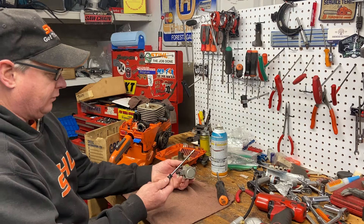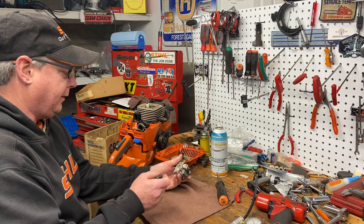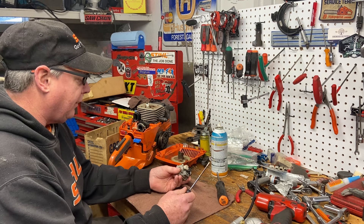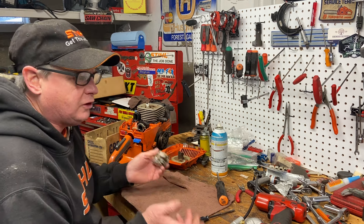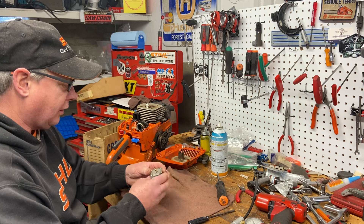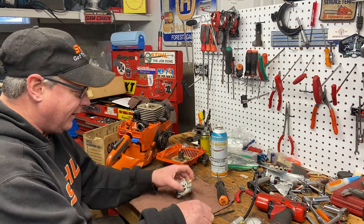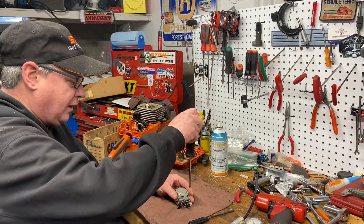General settings are around one turn each, but with a non-rev-limiter ignition you can adjust it to where it runs properly. They normally run around that on these — I can't remember the exact specific settings, but I know how to tune a carburetor properly; I've done thousands of them. Let's start by taking our metering side off.